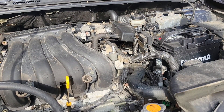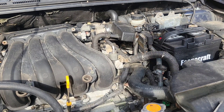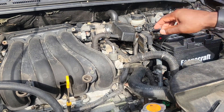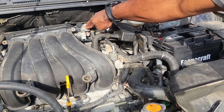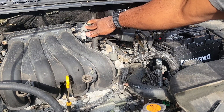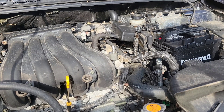Welcome back to another video — if you'd like, like and subscribe, thanks for stopping by my channel. Today we're going to replace the purge valve on this car. The location is here — very simple to do. The customer said the dealership was going to charge over $200 to do it. They tested everything and said it was bad. This may also work on your car if you have a code of P0455.